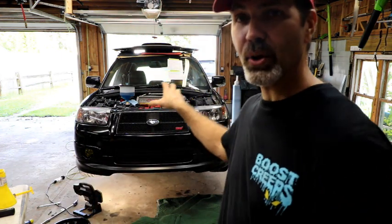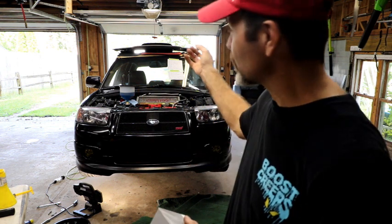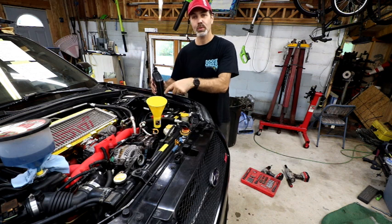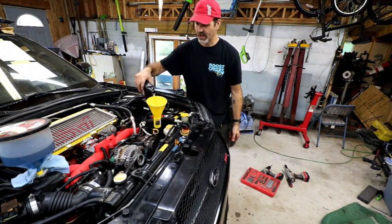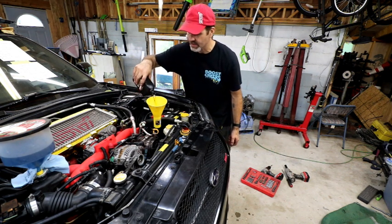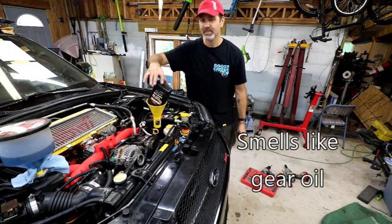So this oil filter is going on there and the break-in oil is going in when it cools down. I'm going to pull my coolant fill apparatus off of there because I've got the coolant bled — I just want it to cool down so it will pull the coolant down into it. I also want to point out this funnel — I love this thing. It screws right into the oil fill and does not leak. I'll drop a link in the description for this as well, because I think anybody who owns a Subaru, as much as we're doing oil on these, needs to have one of these funnels. And this break-in oil is a mineral oil — it smells bad.